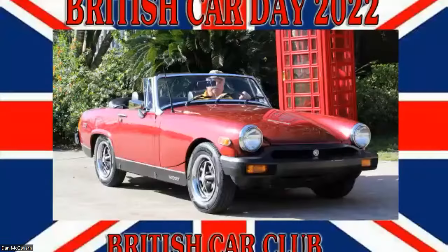John, on your temperature gauges. It doesn't affect any of that. Yeah, but on the temperature gauge, you should mention that on the normal setting on that gauge, if you change your thermostat, the needle reads differently. It reads higher or lower depending on what temperature thermostat you use. Of course. So the normal range, if you got one that's calibrated at 170, 180, 190, you buy a 195 thermostat, and the most you can get out of it is 180. It's because the new thermostats aren't made well. I was talking to Glenn at Glenn's MG Service in Florida.